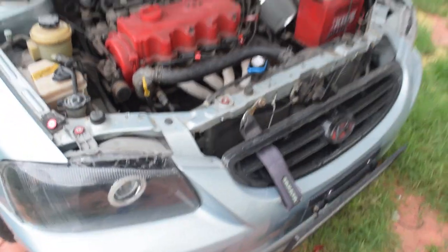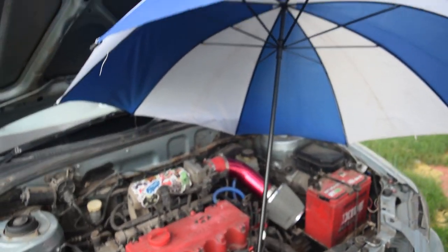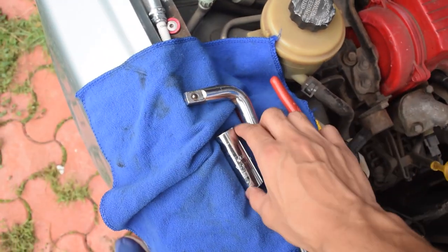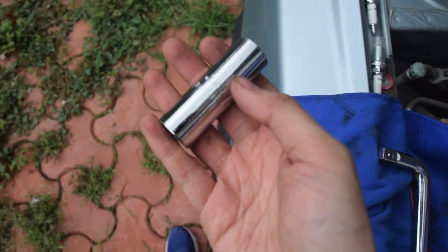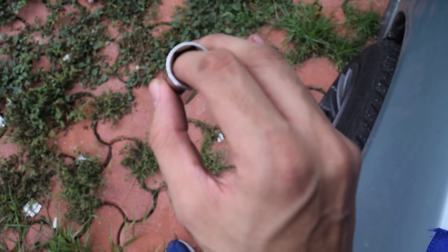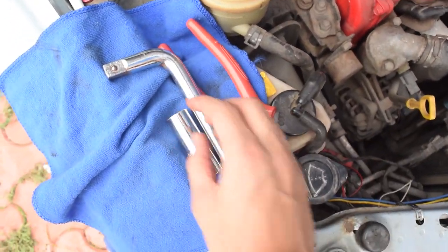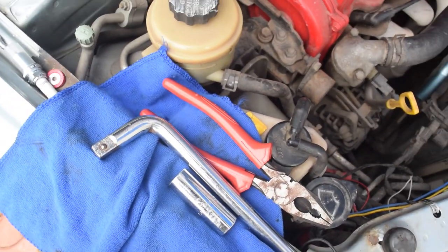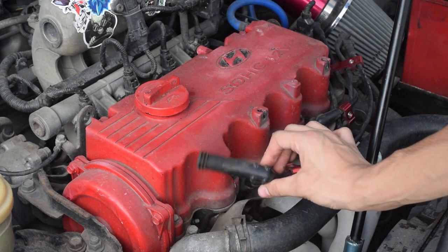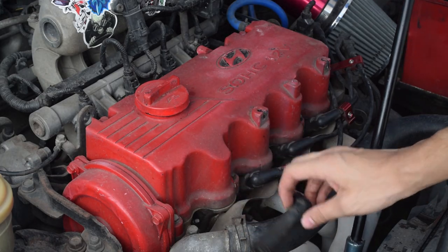It's looking very cute! Now let's install the spark plugs - it might rain anytime so I've kept an umbrella nearby so my air filter won't get wet. For tools we need a spark plug socket - it's a long socket with rubber inside which protects the ceramic of the spark plug during installation - plus a breaker bar and a set of pliers in case it's stuck. One important thing: do one spark plug at a time so the wires don't get mixed up - putting them on the wrong cylinders won't be good.